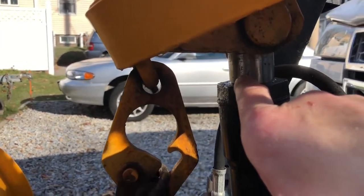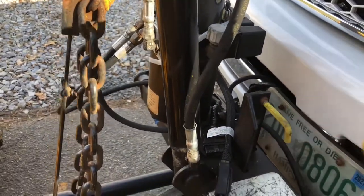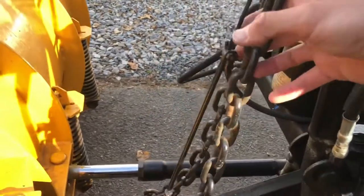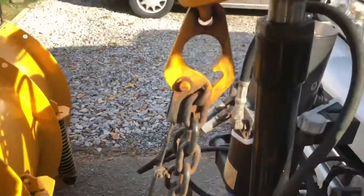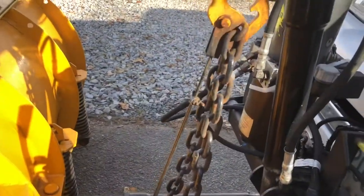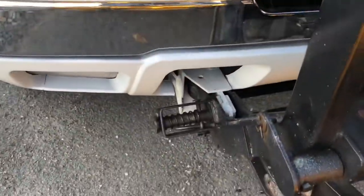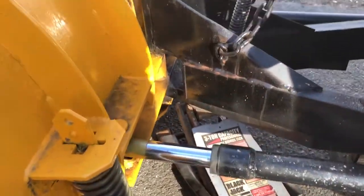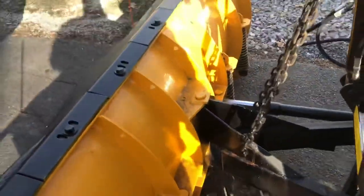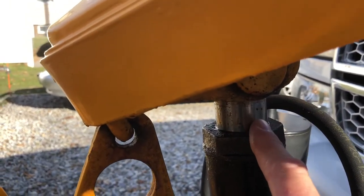When I disconnected my plow to start this video, I didn't put it all the way into float mode. See this little gap right here? I can't push down unless I use hydraulics. This chain is your lift chain — it keeps spring pressure on here with your cable for when you go up and down. We weren't relieving that pressure, so it wasn't allowing this to go all the way down, causing the chains to bind up and preventing hookup. The key thing to remember: always make sure the plow is in the all-the-way-down float position so you have as much slack as you need in the chain when putting the plow on.